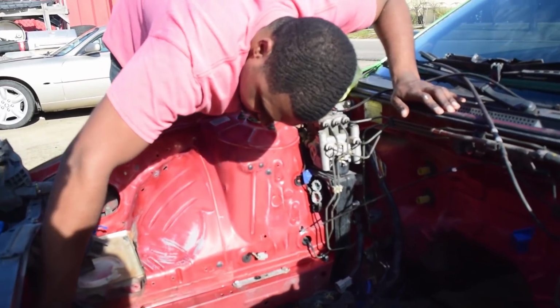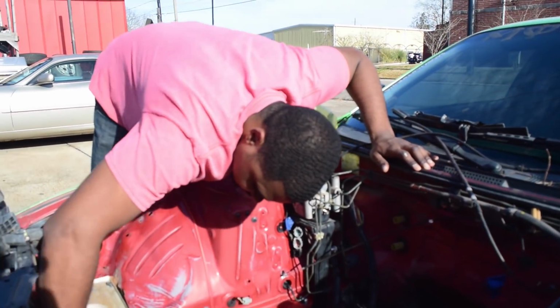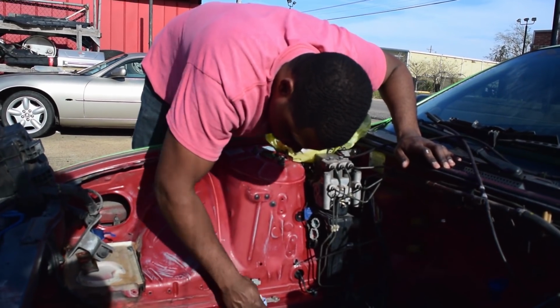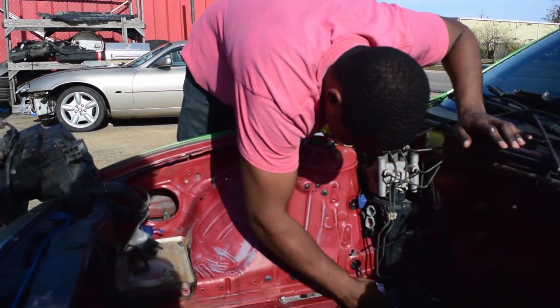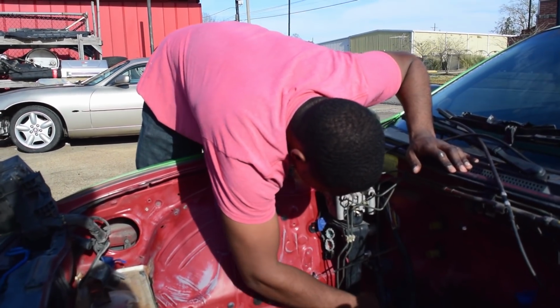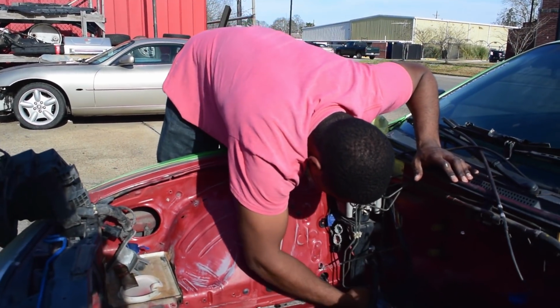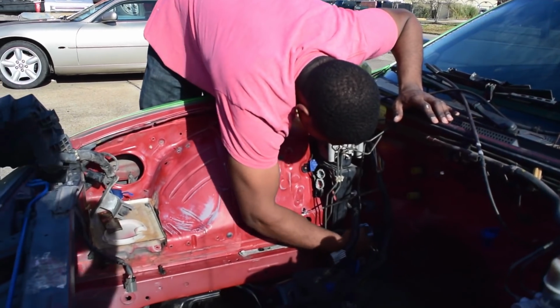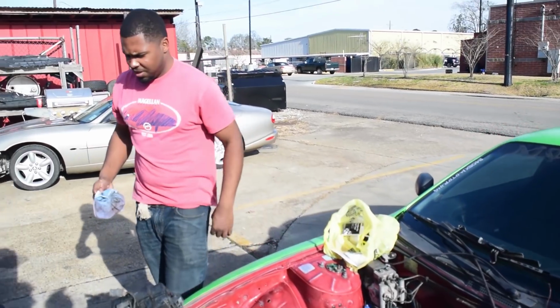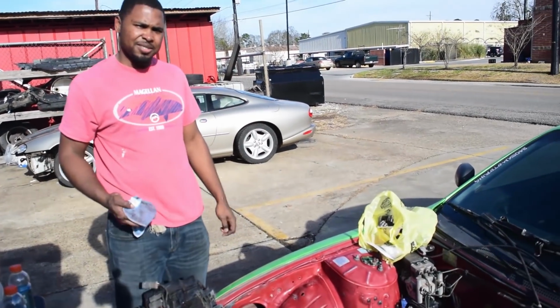So you can probably see now the Tahoe pushes through the brakes real hard. So we probably got to do something with the brakes and get stronger brakes, or see how you can adjust them, because it just pushes through the brakes hard. You can kind of excuse it for a little bit, because you have a 3800 stall. The turbos start building boost, so it's probably making a good amount of power at that 3000. So it's gonna push through the brakes.